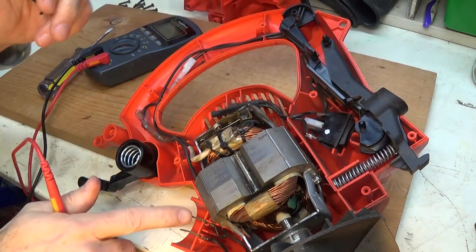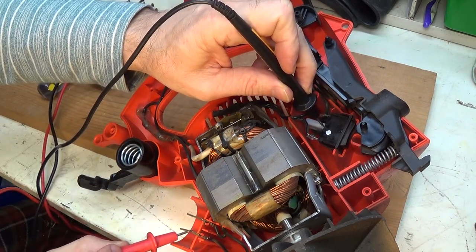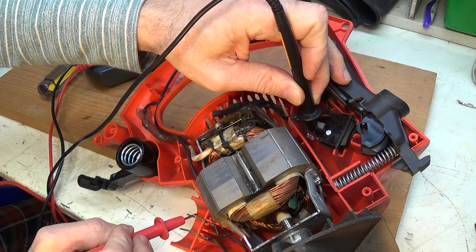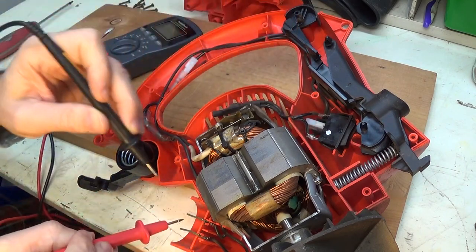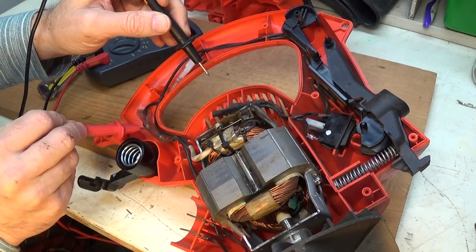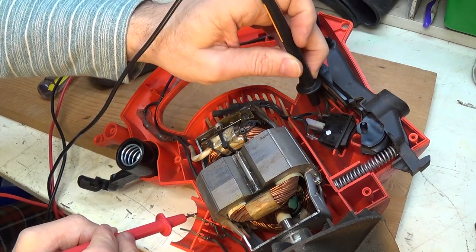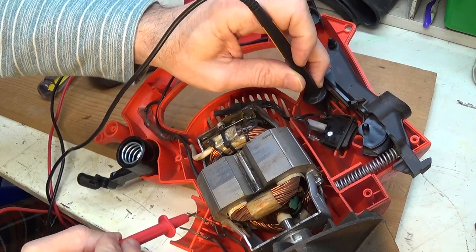So next, I want to go from the switch to the actual plug itself. Again, I think this is the hot lead. So I'm going to contact the hot lead — and yes, there's continuity. So we know there's wire continuity all the way to that switch. Now let's do the neutral lead. No, there's no continuity. So that could either mean the fuse is blown or the motor's burnt out. Basically, the hot lead goes directly to the switch, but the neutral lead goes through the fuse here and goes all the way through the wires in the motor. If there's any short anywhere or any blown component, that will prevent the current from running. So we know the hot lead looks okay, but the neutral leads are not.